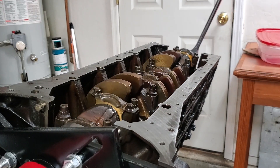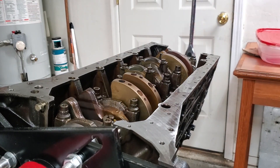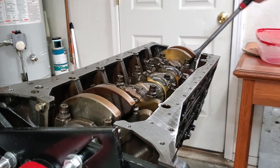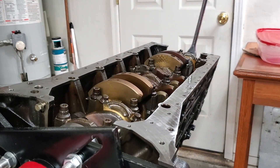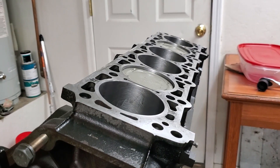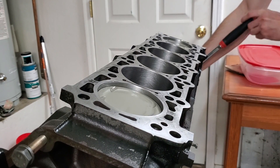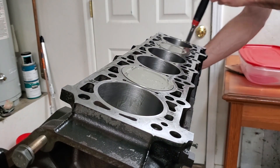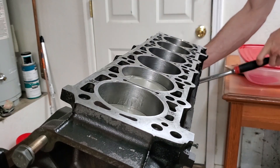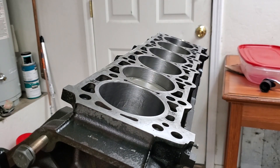And that's it — we have our bottom end assembled. We still need to put the splash guard or baffle on, the oil pump, and then the oil pan, but that's coming up later. I just want to make sure before we bolt everything up with gaskets that we already have all of our bases covered. If you're getting value out of this content, leave a like and a comment, subscribe to see my upcoming stuff, and I'll see you next time.